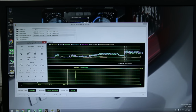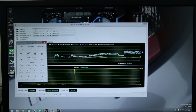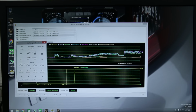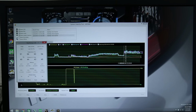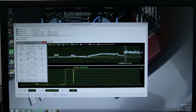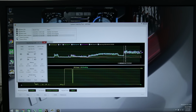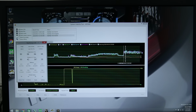And you can see here are the core temps right here on the left. This program's called Real Temp. I like to use this for the cores. So we are sitting a long way from TJ Max. And you can see TJ Max is where the thermal throttling is gonna happen. This right here on the bottom, underneath the core temperature, is how far we have till we thermal throttle. So we've got so much headroom, it's not even funny.